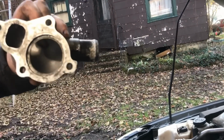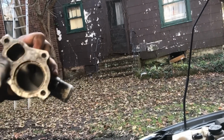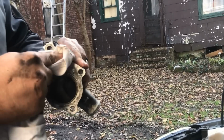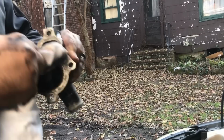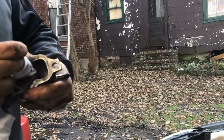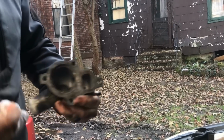Antifreeze, which you can see in here, this isn't corroded or anything. If you find a car that's just using regular water, spigot water or whatever, that will be rusty in there. Antifreeze keeps it from rusting, and it keeps it from destroying your water pump. So never run it on just water. It really does make a big difference. And also, if you're using just water in the winter time, it will freeze and it will destroy your engine block.